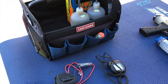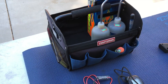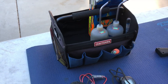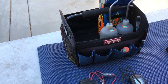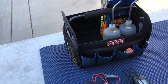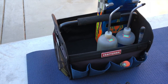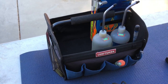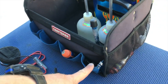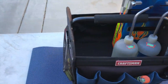Those are the items I always like to keep in my pit bag. Now I'll go over some optional items that could be good to keep in your bag, but those essentials are what I always make sure I have. You don't want it to be too cluttered — if you have all the optional things plus the required items it can be hard to find things and create chaos during a race. With the standard items I like to make sure everything has its own place: wheel wrench in the first pocket, glow igniters front and side, glow plugs and glow plug wrench in their spots.